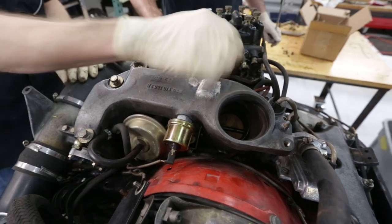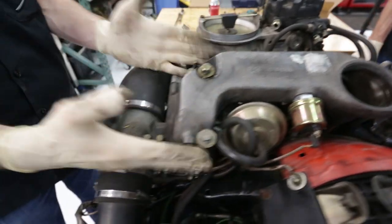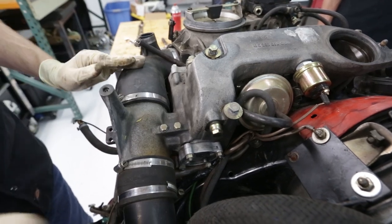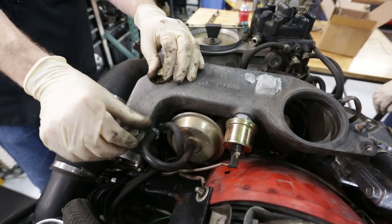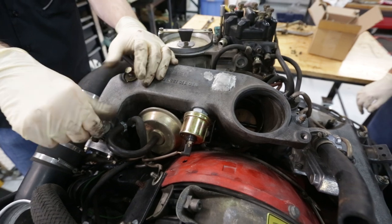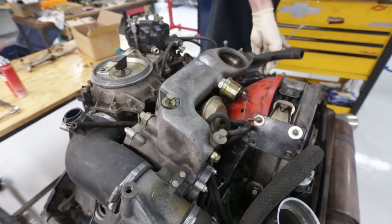So you shut the throttle body here, all this back pressure after the intercooler above the throttle body is pressurizing this, but the manifold vacuum acts against the piston here, pulls the piston up, allows the air back down to the intake of the turbo. This is what, sure, the BMW 2002 turbo came out first, but this is what made the cars actually stay on boost somewhat when you shifted gears. That is crazy. This is what made it work. This is the largest blow-off valve I've ever seen. Yes.